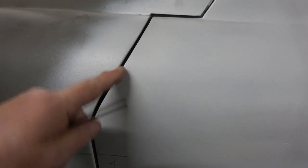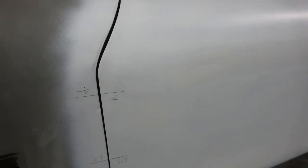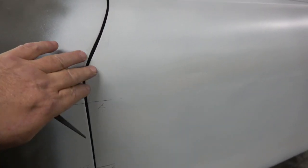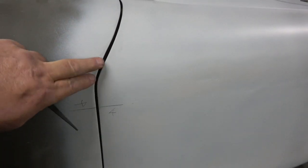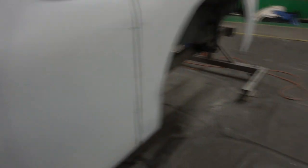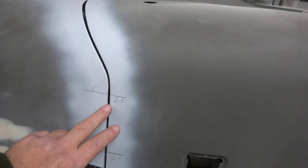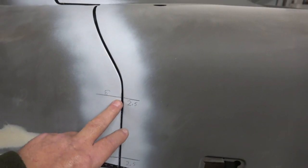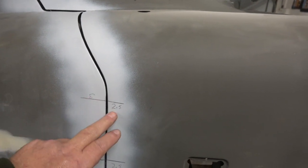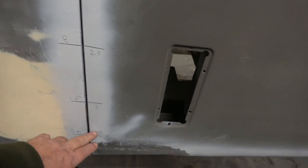You can see here that line is not equal — especially there — so that has to be uniform all the way around. You can see there's half a mil difference when it's inverted versus upright: it's 3 and 2.5, so that's half a mil. Then going around: 3, 2.5, 3, 3, 4, 5, 4.5.